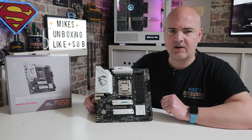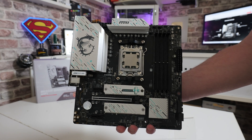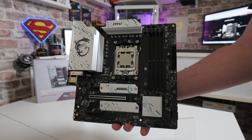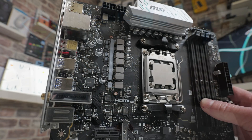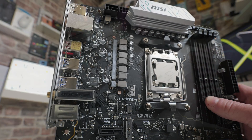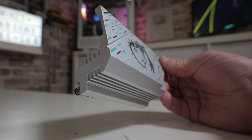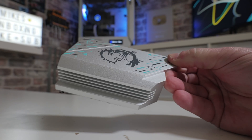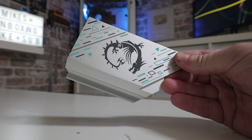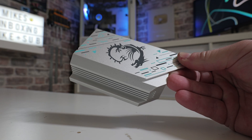One of the first things you'll notice when you receive this board is that it's actually really heavy — they've included a lot of heatsinks. There was a recent Hardware Unboxed review of some lower-entry MSI boards where some performed poorly with their VRMs. This one, with its 10+2+1 VRM phase and some pretty chunky heatsinks, should do pretty well. That said, at £140 on a B650 board you're probably not aiming for a 7950X — for mid-range Ryzen 5s and Ryzen 7s, this will be absolutely fine.